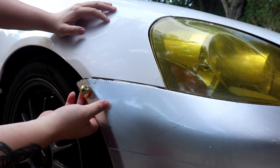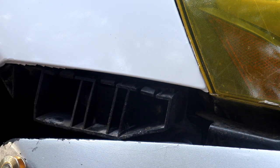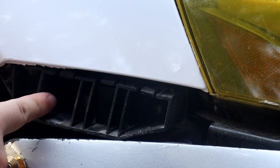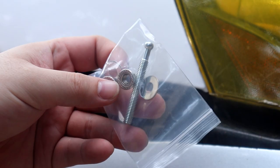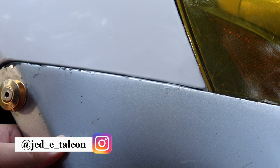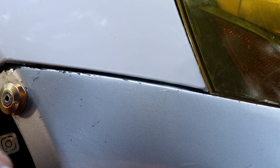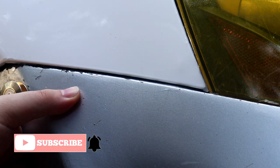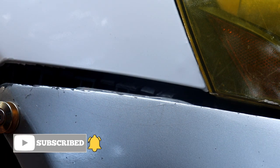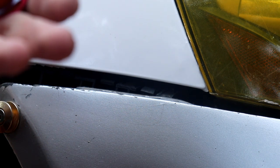You can take off the entire bumper if you want, but I'm just going to do this. In here there's a screw — I'm going to take that screw out. This plastic has clips on the back; I'm going to take those off too. I'm going to put one of these in through there, and then once that's set, put the bumper back where it's supposed to be. Probably with toothpaste or something, mark behind the bumper so I know where to drill. Then I have a step drill to drill out that hole to the right size.